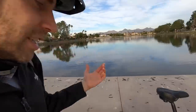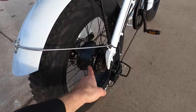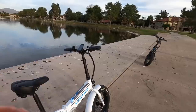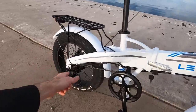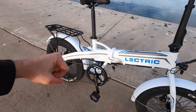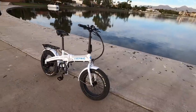Compared to buying something off eBay or directly from China without customer support or warranty, you're getting a customized, tested, warranty-supported motor here. It's a fat bike-specific motor with gearing set up for smaller wheels. The bike ships with a 20 MPH top speed but can be raised to 28 MPH (45 km/h) in the display settings. With seven speeds and the 14-tooth freewheel balanced against the 52-tooth chain ring, you can do it — you do spin a little faster at higher speeds.